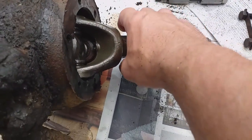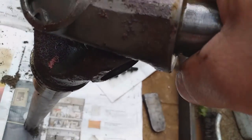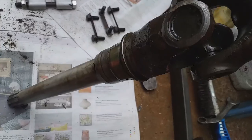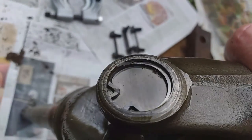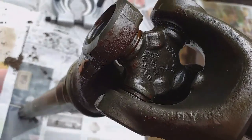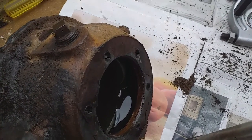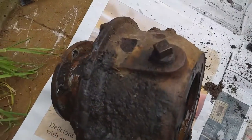At this point the half shaft should withdraw - and it does. A little bit of a messy withdrawal; on quick surface inspection it's not too bad, just some minimal surface rust. It's a Hardy Spicer UJ or journal. The circlips look like proper ones, not the ones with little lugs that are easy to remove with circlip pliers. I'll put that in a safe place. Continuing on to split the swivel pin housing from the bearing housing - actually the UJ isn't seized, it must be the swivel that's stuck.